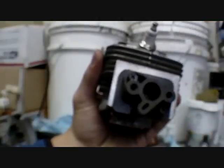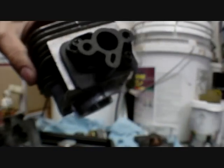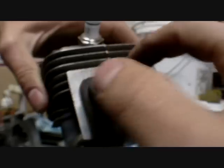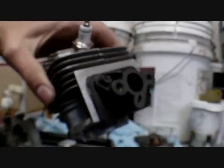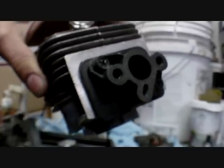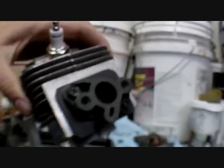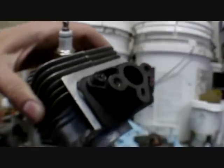Use 80 grit sandpaper or around there. Not too rough, like you don't want to scar the metal. You just want to brush it so that it's not super slick. You want it to be rough for that surface tension not to be there. You want air and fuel to flow fast. What this will do is it'll provide better dynamics for high RPM situations, better speed, better acceleration, because more air and fuel can flow through the motor faster.